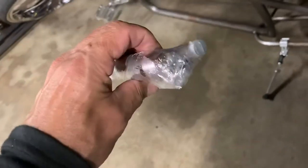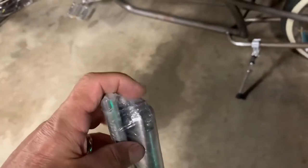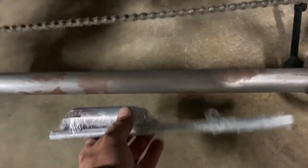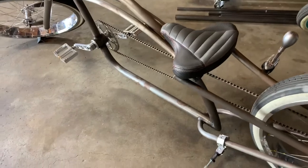Project number two: adding this Michigan Built billet kickstand, which has a weld-on tab right here. I'm going to weld it to this Tail Dragger Type 2, except we have a problem — it got a flat on its own. I have to swap that wheel out so the frame is level when I weld it on. I cheated a little — put some angle iron under there to represent the tire, got the frame leveled out. The nice thing is we already have one kickstand on, which is already giving us the stance.